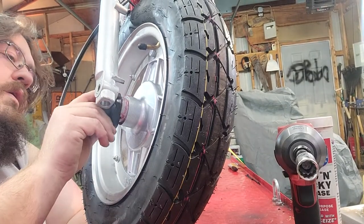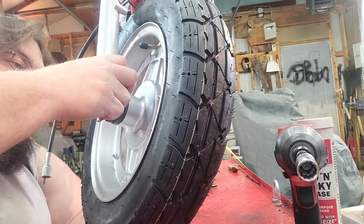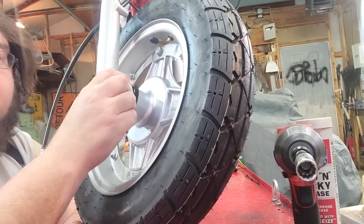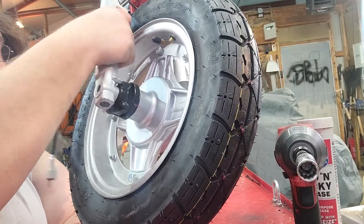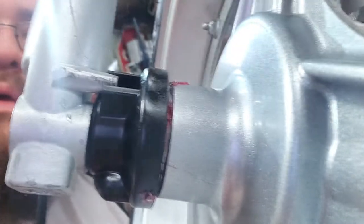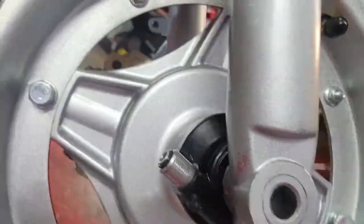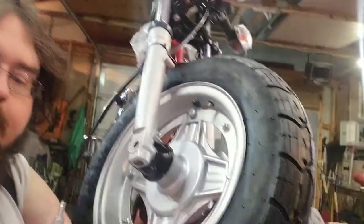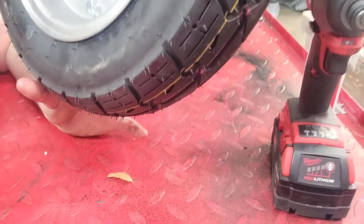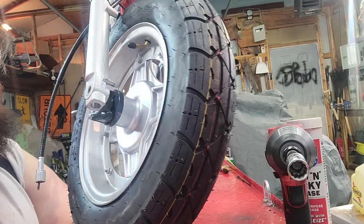Take that and let the wheel fall just a little bit. If you're having issues sliding this, rotate the fork. Once you can see where that's locked into place, your cable attachment is back here towards the back. Support it from the bottom.